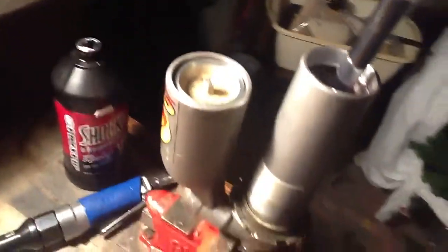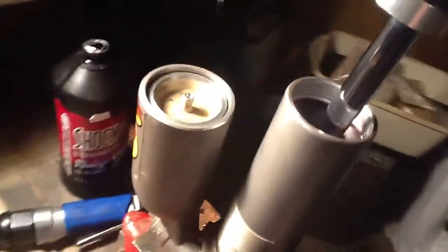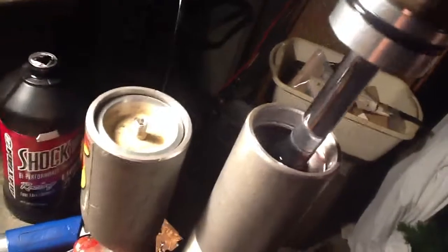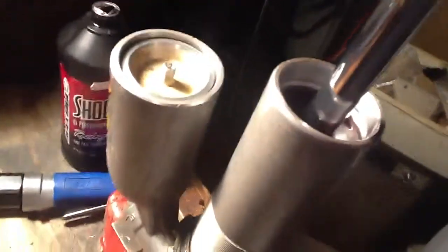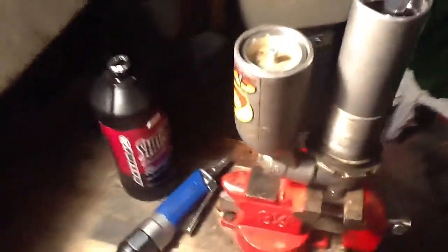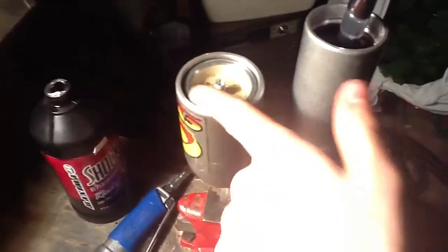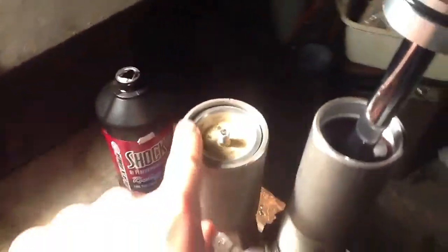I haven't really done anything, so what I'm going to do now — or what I've already done — is I've just pumped the shock up and down as much as I could until there's no more air. What I realized is there's some breakdown with this shock: the bladder's messed up, so it's going to need a new bladder, because it's squirting air and grease everywhere. And this bushing's messed up — that's way too much play.